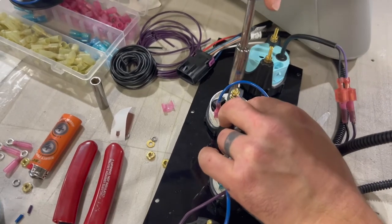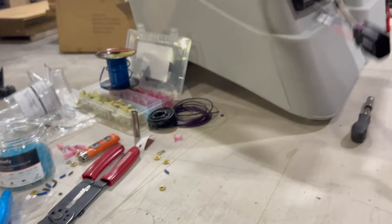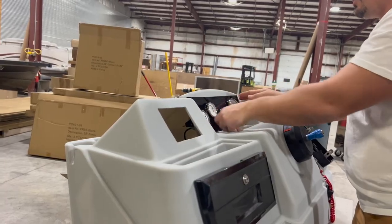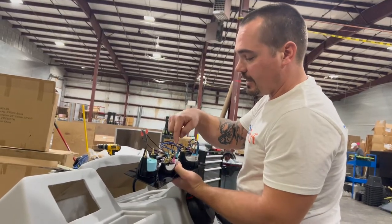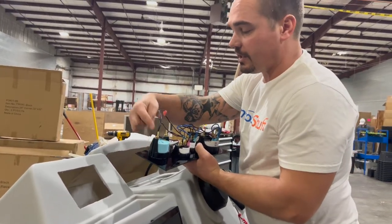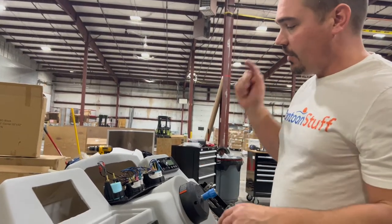That's how it looks on the front. The best part is this whole panel will just slide right in like that, and now I've got my gauge panel ready to go. When I get it up in the boat, all I have to do is pull this out — I can get my sending wire and ground on my fuel gauge, the transducer wire can plug in here, it's all going to come right up through. It's easy to work on when we have it like this rather than any alternative. So I'm going to go ahead and climb up, get ready to put this console together, and run those wires.